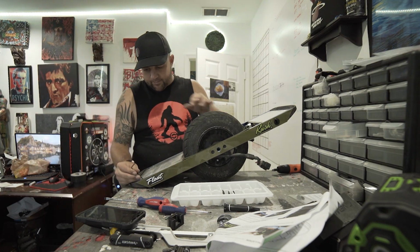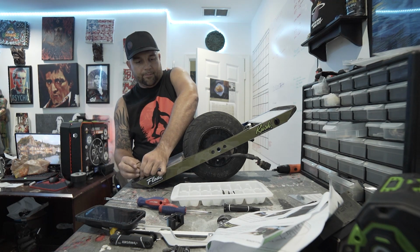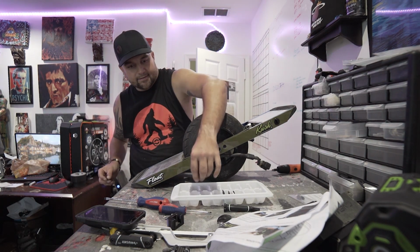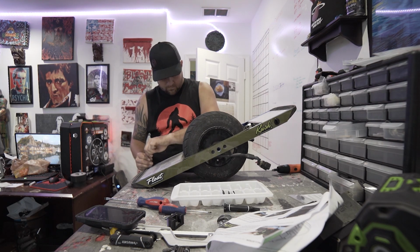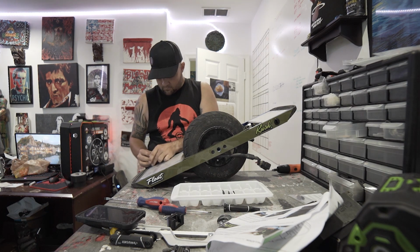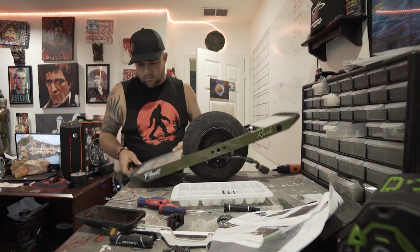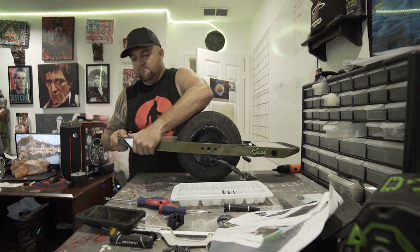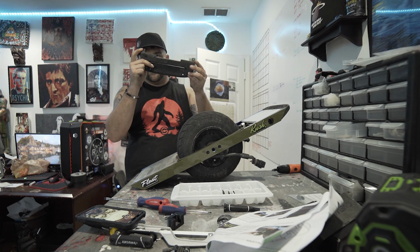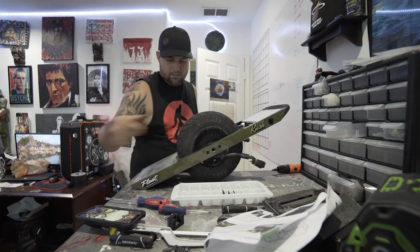What's next is bumper screws. A lot of people forget about these and pull on the bumper and break a tab because they don't realize they've got these little guys in there still. Remember when plus bumpers were all this small? Oh yeah, look at that. This thing's definitely seen some better days.